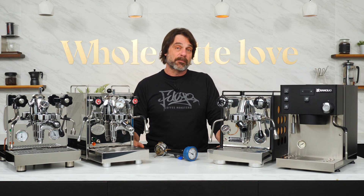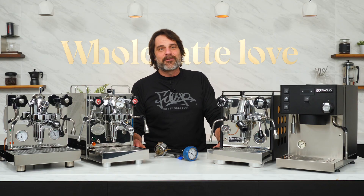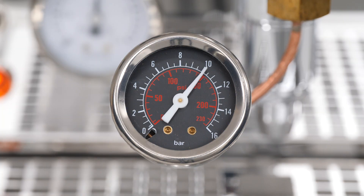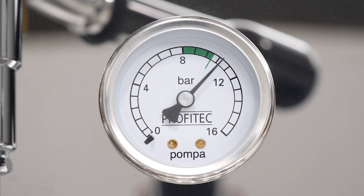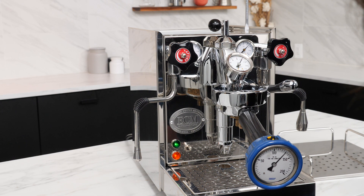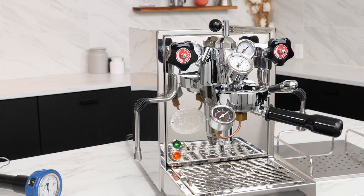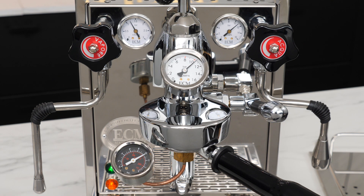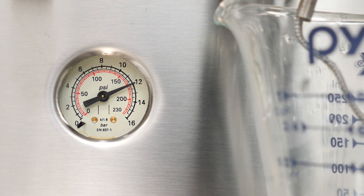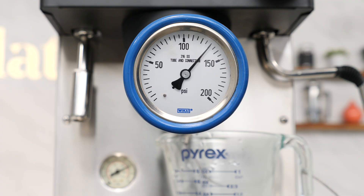In most machines, the further a gauge is from the group, the higher the static pressure difference between the measuring point and group pressure when extracting. Machine-mounted gauges generally measure pressure right after the pump in cold water, so they're about as far away from the group as you can get. As the water works its way through the piping, friction and other restrictions combine to lower the pressure before it reaches the coffee. When this Profitec Pro 500 is tuned to produce 9 bar on a Scace, you get a static pressure of about 10 bar on a portafilter or group gauge and about 10.5 bar on the machine's built-in gauge. When I adjust the OPV on this ECM Mechanica Slim to a 9 bar Scace pressure, the static pressure clocks in at 10.5 bar on the portafilter and group gauges and 11 on the machine gauge. On this Rancilio Sylvia Pro X, the machine gauge reads 12 bar of static pressure when I adjust the OPV to produce 9 bar using this Scace.